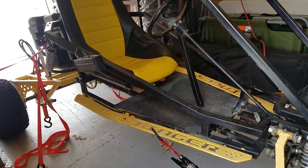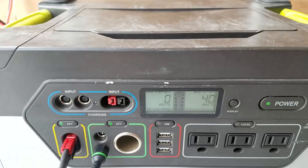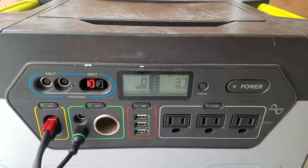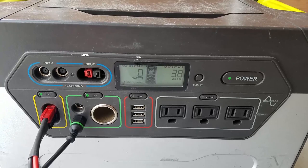In about 30 minutes this trailer should heat up to a comfortable temperature. Right now it's drawing 39 watts — that doesn't include the light in here, which draws about 9. I've seen it as low as 26 watts, but maybe that was when I had a low battery, which is why it was behaving funny last time. That's hardly any watt draw, and I have a spare battery to go with it, so I'm sure I could use this for a week or two without any power connections.